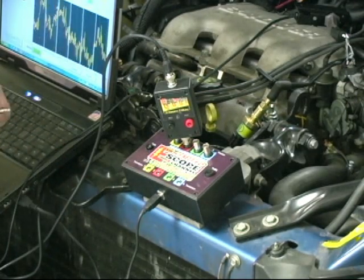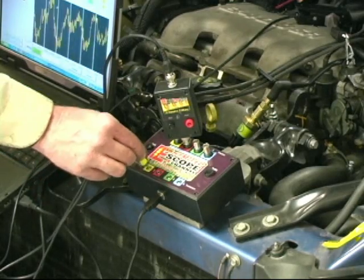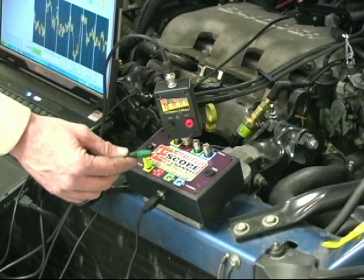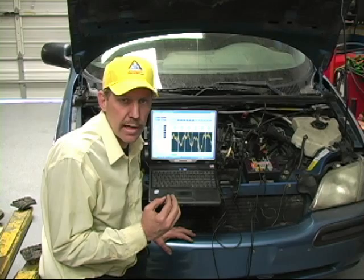And we're going to now plug in the 300 pressure transducer that goes to cylinder 1 in channel 1, and we're going to connect the -30 or vacuum transducer in channel 3. We're going to change the configuration now so we can read the pressure transducer we put in cylinder 1 and the vacuum that we put in the intake manifold correctly.